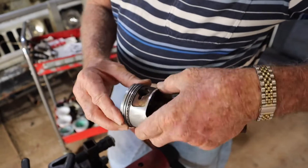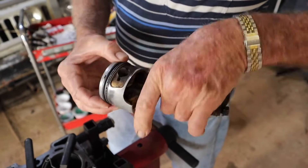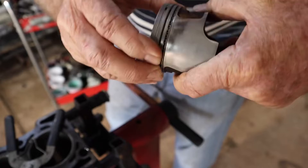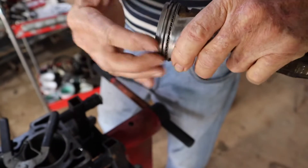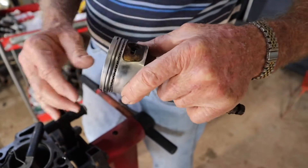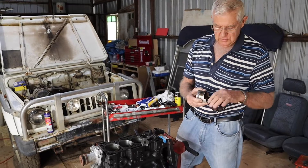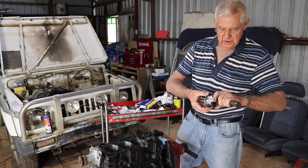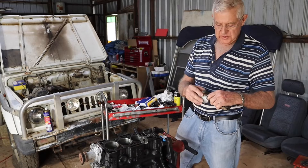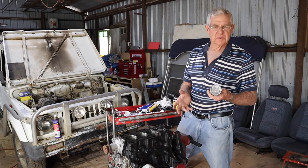Now they're in there — it's always a good idea when they're back on to give them a turn, make sure they are going fully into the full depth of the ring groove and everything is clean. Hold down on them a bit and give that a bit of a shave, make sure it's clean. You can get compressed air and give them a shot of air down where the joins are to make sure everything is nice and free. The oil ring has got to be free. Then we'll stagger them, fit the big end bearings into the rod, oil them, turn them, make sure the oil goes all the way round down into the grooves, and then we're pretty right to put the ring compressor on, compress the rings, and fit the pistons to the cylinders. I'm going to do another video showing how to fit the pistons to the engine. Thanks for watching.